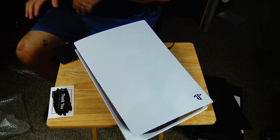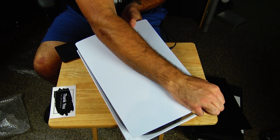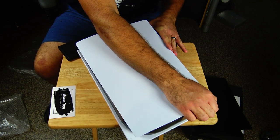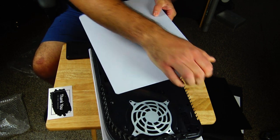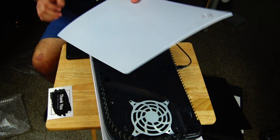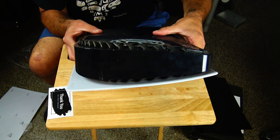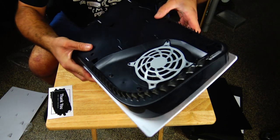Now I'm taking off the PlayStation 5 face plate and it's super sketchy. One thing you have to do is hold the back of it and put either your right or left hand on the top, then lift forward while sliding down — that is the key to removing it. You want to hold it in place, lift up, and slide it down at the same time.